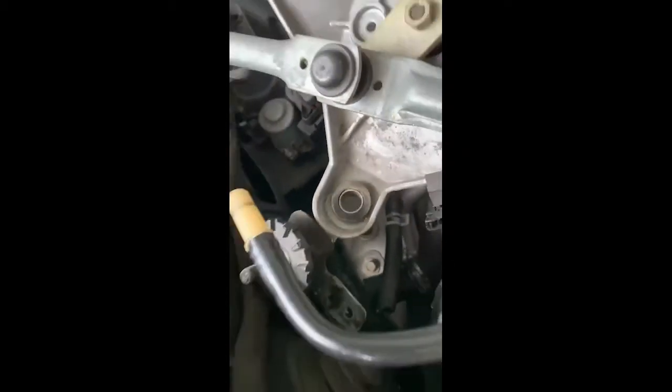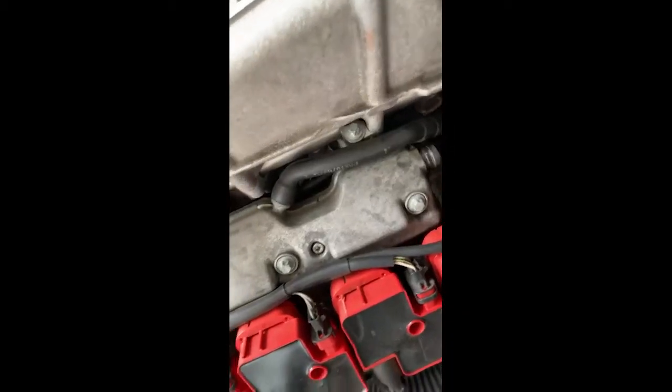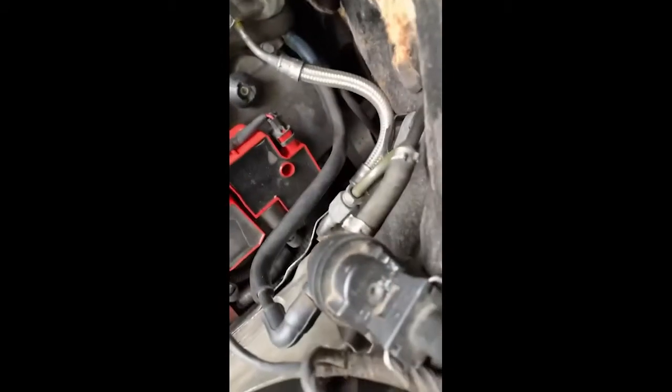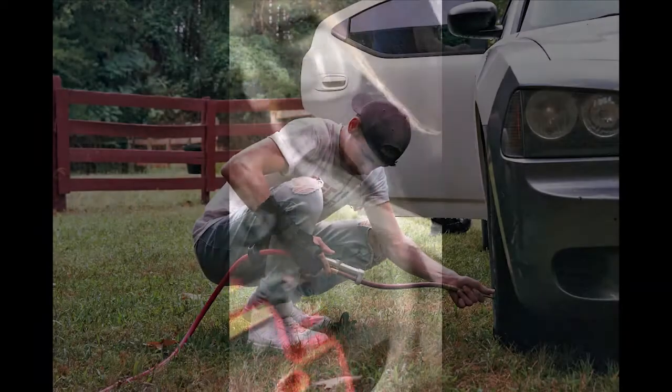I had to bend this little frame back just a little bit to clear that. I'm already ordering all these hoses — this one is for crankcase ventilation, and this right here is like a fuel canister or something. You can even see on that little rubber right there it's getting cracked, so that's the next hose to replace.